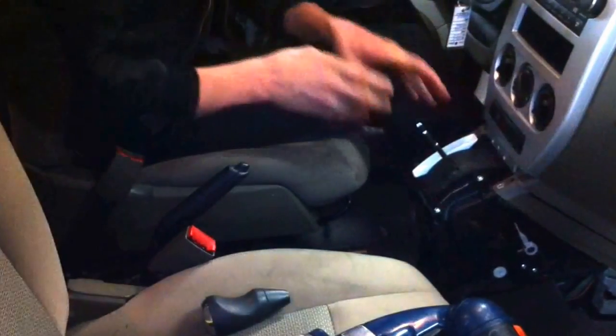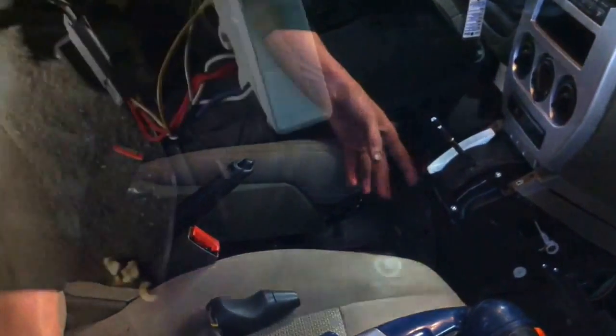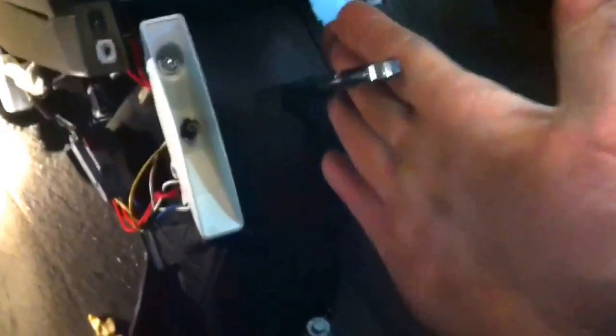I can already see some of the bushing laying on the floor down here. I'm going to move the camera to show you this — please excuse me if it jumps around a lot. Here's our shifter handle; we've already got that front cover off, center console, rear portion gone as well. Without even touching anything, it almost looks like a macaroni noodle there, but it's not. It's actually a portion of the rubber composite bushing that goes into the shifter cable. As you can see, it's broke off and usually accumulates on top of the carpet between the front halves of that center console. So now we know for sure what our problem is — we definitely have a bushing failure. We just need to get our replacement bushing and then work on installing it.